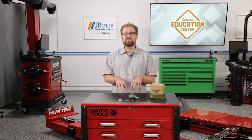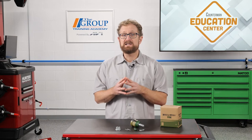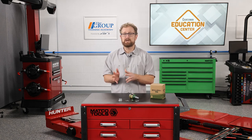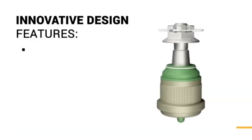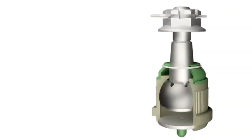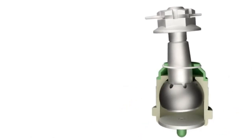Fortunately, the aftermarket has developed a solution for memory steer in these vehicles. MevoTech designed its TTX snap-in bearing from the ground up to address the challenges of memory steer on solid axle applications. Available on all TTX telescoping ball joints, the patented design allows for continuous and exact pin realignment through pivoting motion, which prevents binding or memory steer. The bearing and stud work together to withstand increased off-center loads through telescoping and swinging motion, and the oversized sintered metal bearing has a large contact area engineered to accommodate the challenges of a worn knuckle.